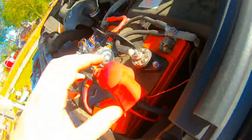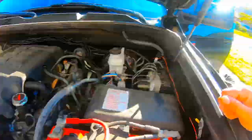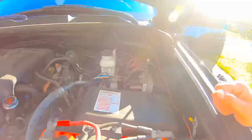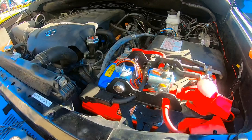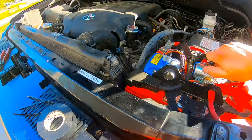What I did was zip tie the wire — I ran it up and have it next to the amp power steps zip tie, along one of the main wire harnesses, and then hooked it up to the positive side of my auxiliary battery. So no matter what, when these work they'll only pull juice from my auxiliary battery and will not pull juice from my cranking battery. If you're interested in what this dual battery setup is, just put it in the comments below and I'll do a video on it — I've had it about a year now and it's amazing.